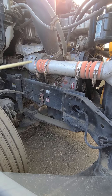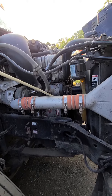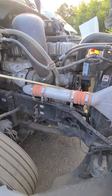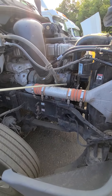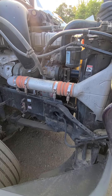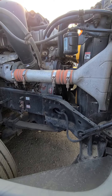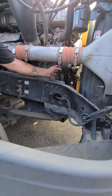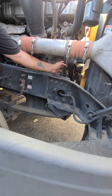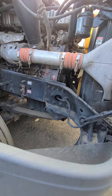Now from there we're going to go to this belt right here. This is not an alternator belt — even though it is — but all we call it is the belt. My belt is properly mounted and secured. It is not cut, torn, or frayed. You will be required to reach in here, tug on it just like this, then you need to tell them it should have no more than three quarters of an inch of play when you pull on it.